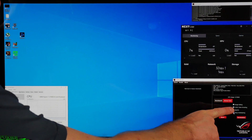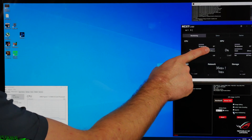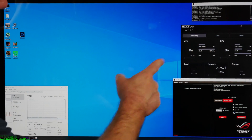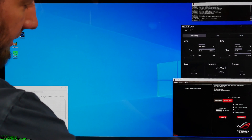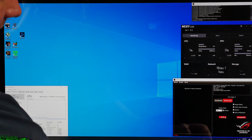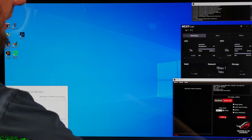For testing we're going to do H.264 video encoding, because that's only going to use the CPU. I would use image editing, OpenCL, or heavy multitasking, but that's not going to push the CPU as hard as H.264 video encoding. We've got it running at about 4 GHz at the moment while idling, sitting at about 32 degrees doing nothing. We'll come back in about 30 minutes and see what kind of temperatures we're getting.